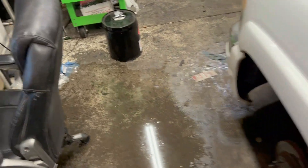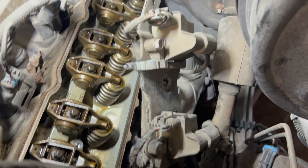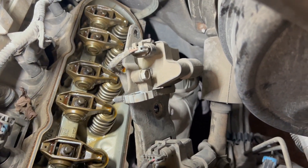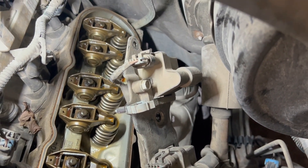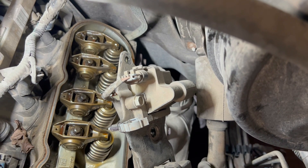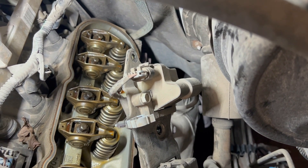There's a pretty pronounced noise, but nothing I can detect that would say definitively 'that's bad right there.' What we're going to do - something I've never done before - is remove both the exhaust and intake rocker on number seven. That should lift the cam lobe all the way up and get the roller off the cam, to see if the noise goes away.